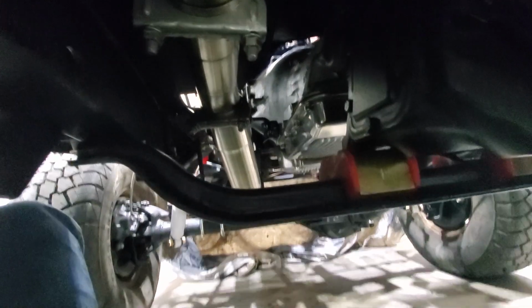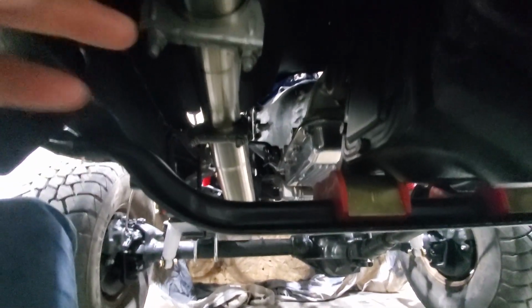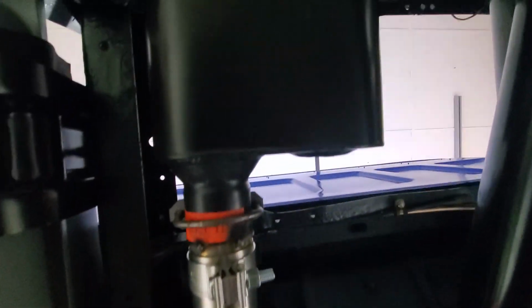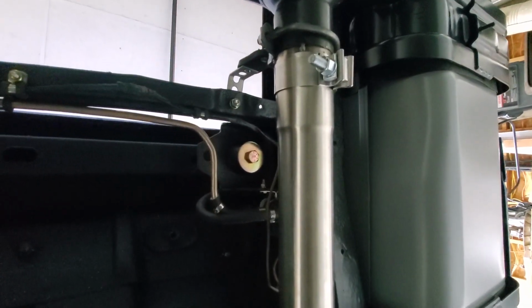And then if I follow this around, I have two 45s held together with just these basic exhaust clamps. There's the transmission, and the pipe goes up just a little bit with the 45 and then levels out again with the other 45 to get over the transmission cross member. And then from there it goes on back to the Flowmaster 50 series. And they're that way on both sides. It's the same thing. So here's the passenger side doing the same thing, band clamped there.